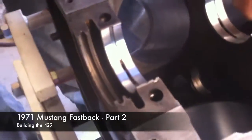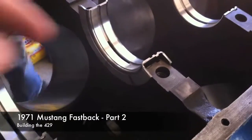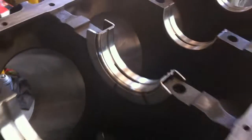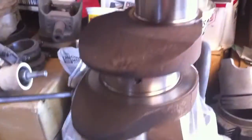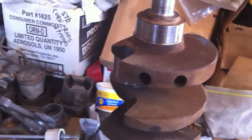So there are the new bearings being placed into where the crank is going to be laying. This center one has basically a flange on it. The reason that center one has the flange is that it takes up the thrust — that's the very center of the crank and that's where it fits into. Can I lay it in? Yeah, but I've got to get my hammer first.